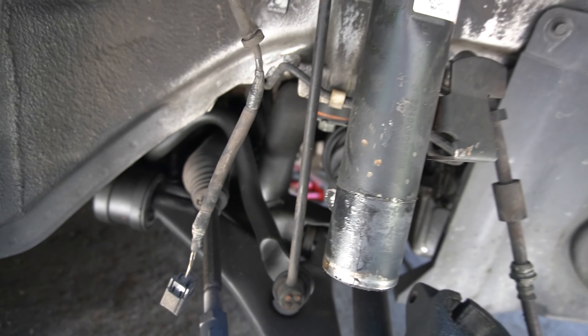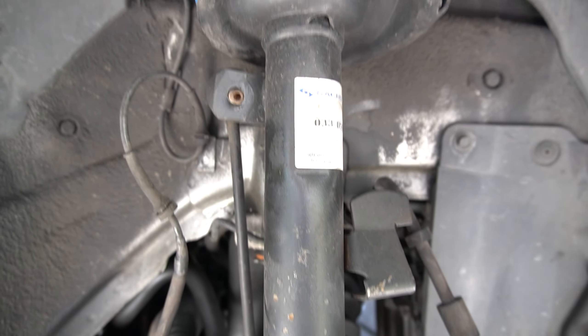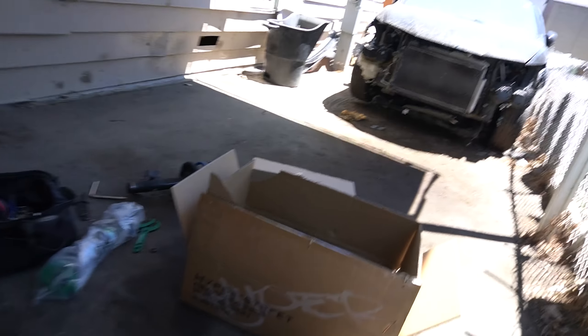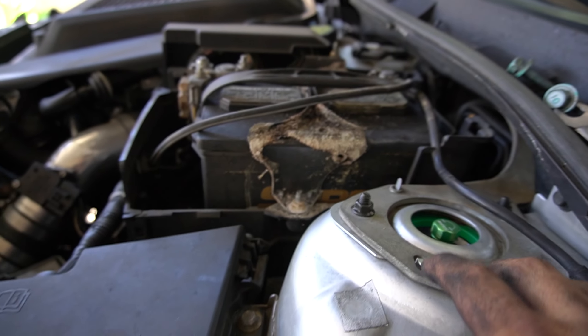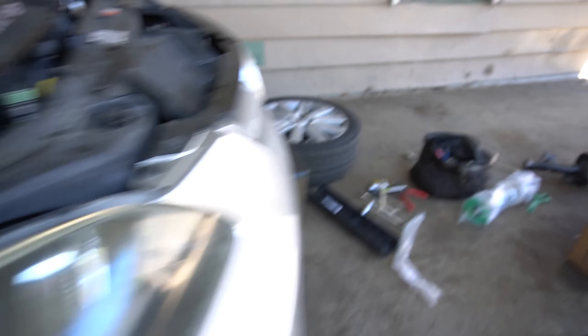After a couple slides that came off nice and smooth. Now I'm going to take out the three bolts and put the new coilover in. One thing to note: the bolts that came with the coilovers are a little too small, so I had to add some washers. Other than that, torque the bolt — that one's about 30 foot-pounds, the other about 50. Then we're good to go.